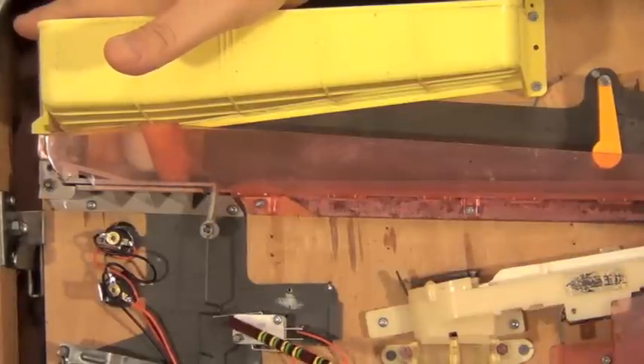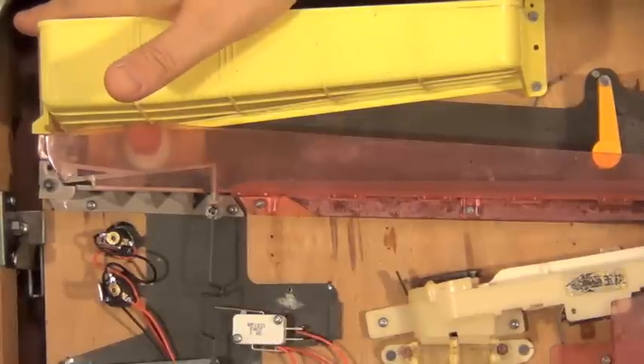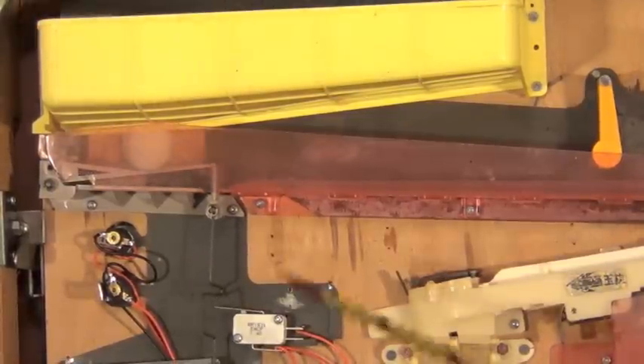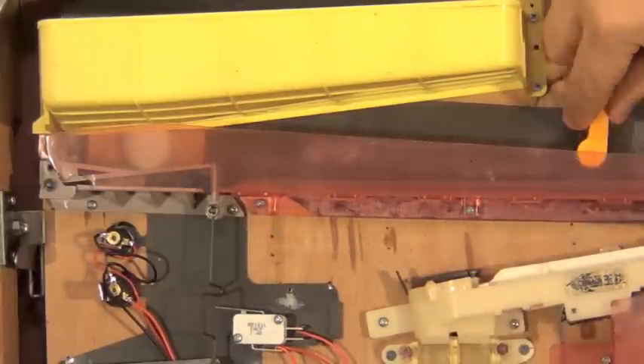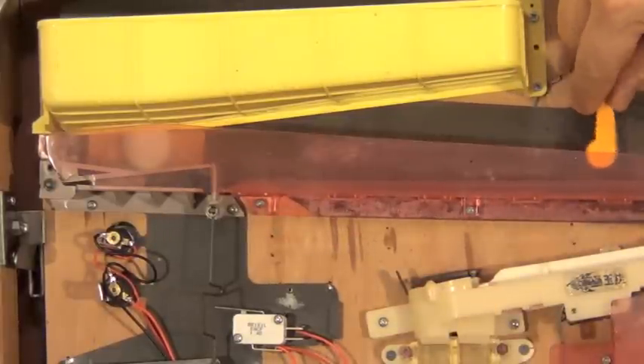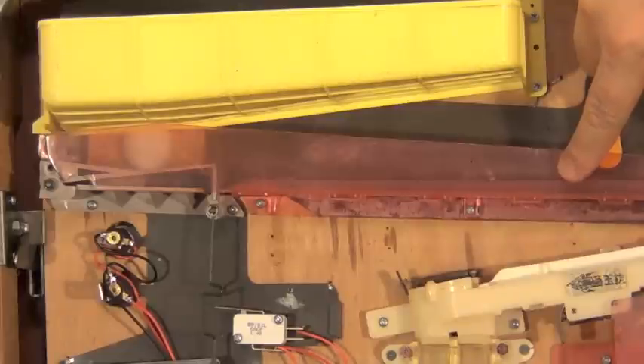So the activating arm of the switch needs to be below this wire, the way this one is currently hooked up. Now as balls go down the track, they'll hit this swing here. The swing needs to be down, and what it does is step down the level of balls so that when they enter the turn there, they are only one high.